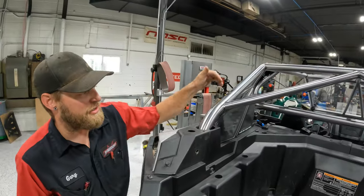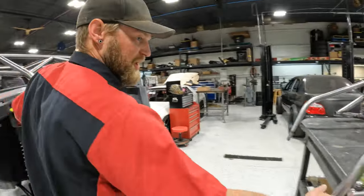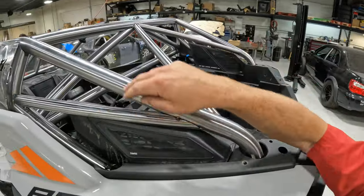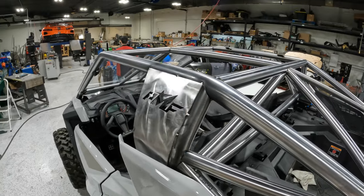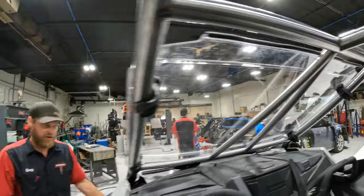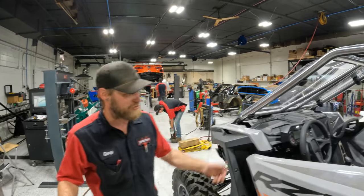We actually triangulate your rear down bars — this is the point that picks up the rear of the chassis. In the other cage, you can see they just kind of hang. They're still a lot stronger than the original, but they are not supported directly. In this case, dual triangulation ties up the rear corner — this is much more what you'd see in an actual race cage. And then the other part that's noticeably different are the anti-intrusion bars in the windshield itself, generally to keep anything from intruding. You catch a deer with these, they go through the windshield — you hear horror stories all the time. That's where those bars got their name.